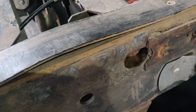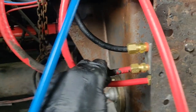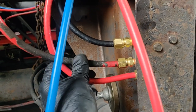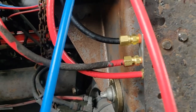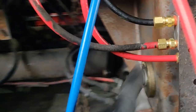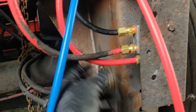If you push the knob inside, the pins will come out. If the parking brake is applied, you will be able to open the pins. If the parking brake is released, you will not be able to pull out this knob because you will have pressure in this line, and when you have pressure in this line you will not be able to open the pins.